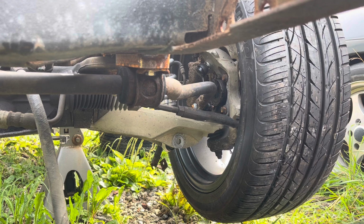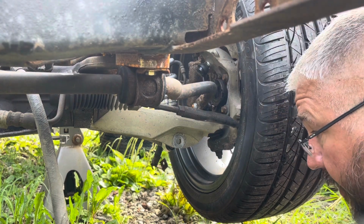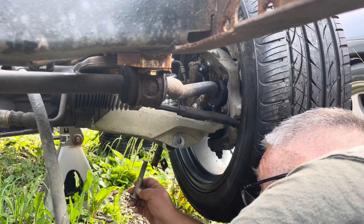Okay, I'm going to put this bottom bolt in and get it all cinched up. Just make a note that, first, the socket is a 24 millimeter, and if you leave the top A arm bolts loose, it makes it easier for the wheel to go up and down, so you can get the bottom bolt hole lined up and everything. So we'll crawl down here and see what we can do. This part definitely would have been easier with the tire on.